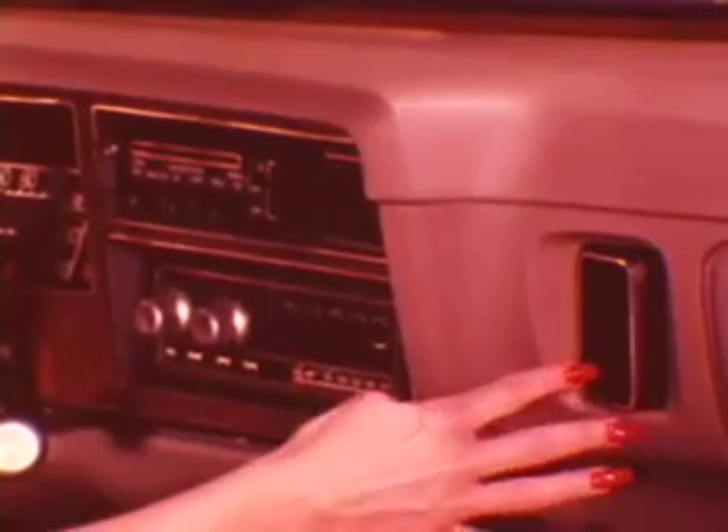The push-button control unit, temperature lever, and blower switch are identical to those used on our larger cars. Four independently adjustable outlets direct and distribute upper airflow. A new three-position control lever directs a portion of cool air through the heater outlets in max AC, AC, and vent modes. Located behind the modular instrument panel are the ducts which carry heated or cooled air to the passenger compartment.